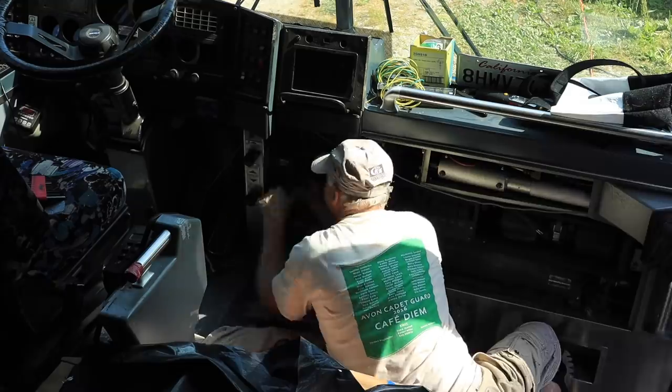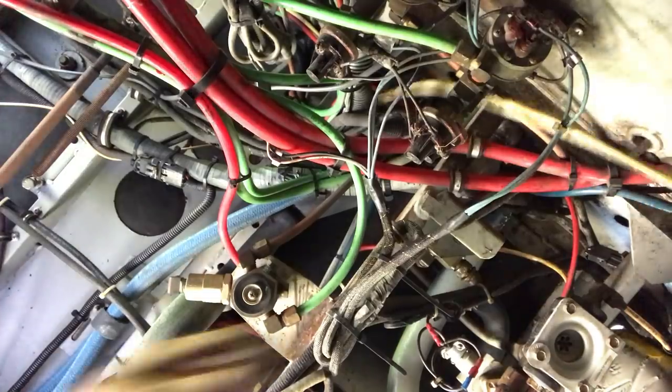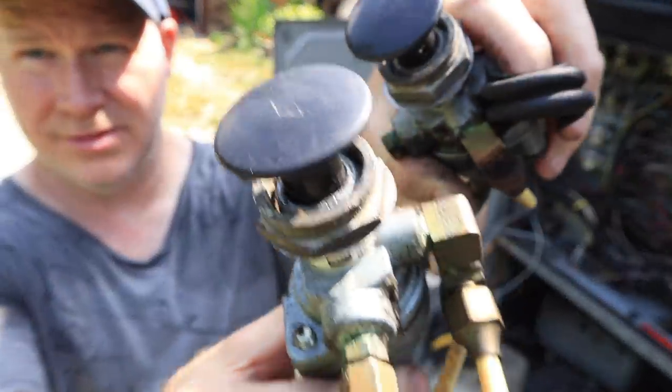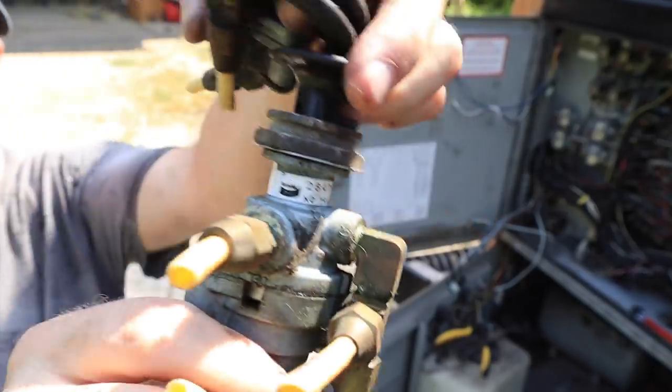While we were pulling the unused electrical lines, we went ahead and removed the air lines to the luggage bay doors. We plan to replace these with electric locks. We went ahead and capped the air line to the compressor up front and hope that's not gonna mess up anything on our air system.